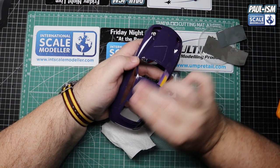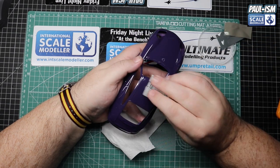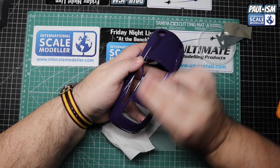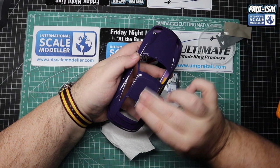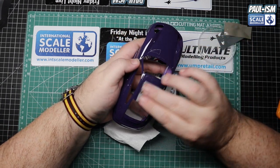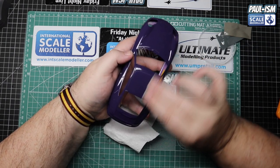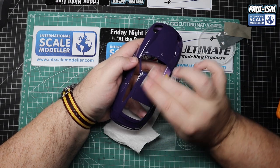And we're on to the 12,000 now. Keep it wet, like so. And just keep wiping it down, checking. And if you're not happy that it's gone, repeat. But just remember, it's easy to stop before you go too far, and going too far and wrecking everything. So take your time here.